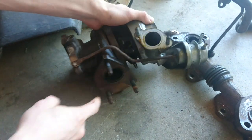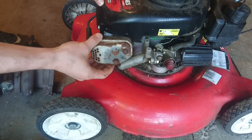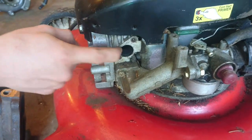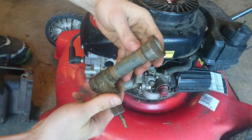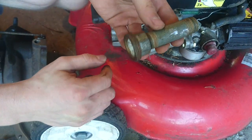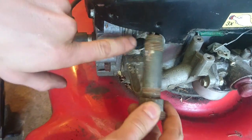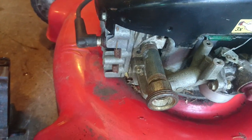The first mission is figuring out how to attach the turbo exhaust inlet to the lawnmower exhaust. I've removed the stock muffler — there it is — and rummaged through the garage to find this weird-looking piece of plumbing. I've separated it to see if any parts are usable. I have an NPT fitting going to a larger pipe fitting, and it is almost a perfect fit in the stock lawnmower's exhaust port. Since it's steel going into cast aluminum, I think I can almost self-tap it in there.